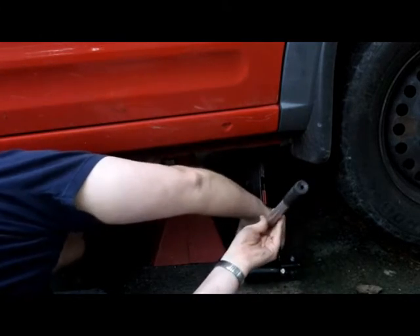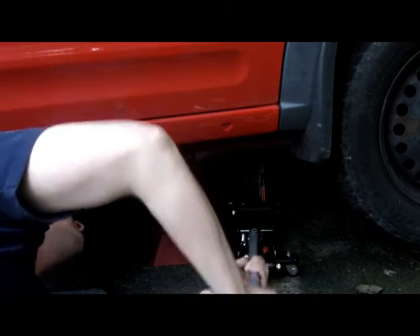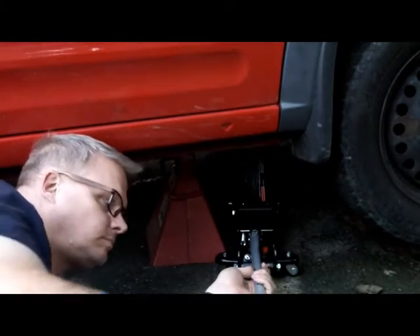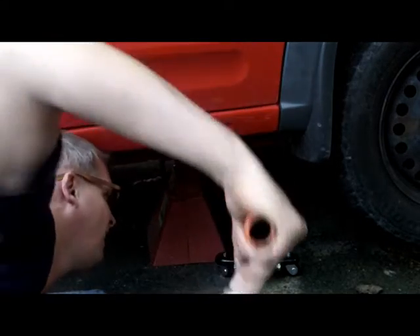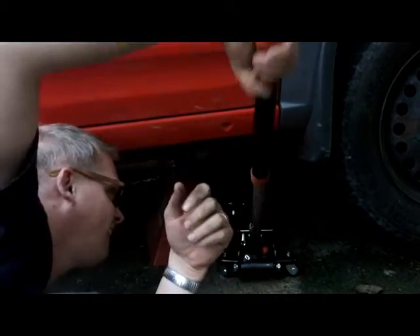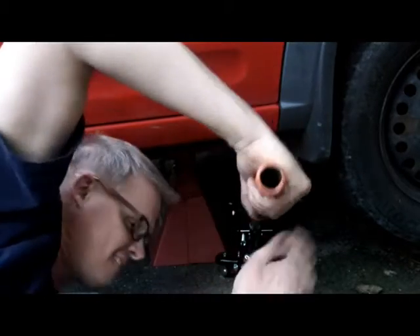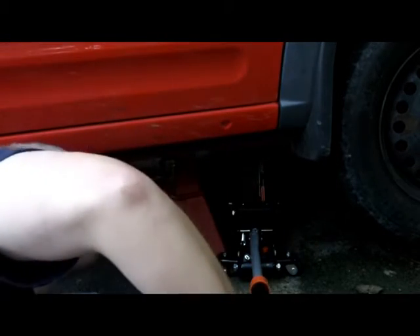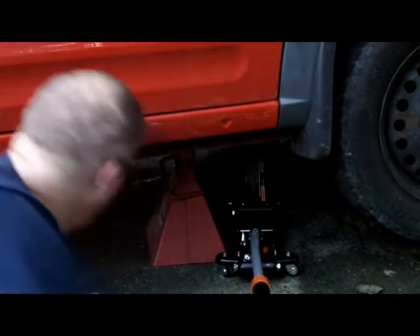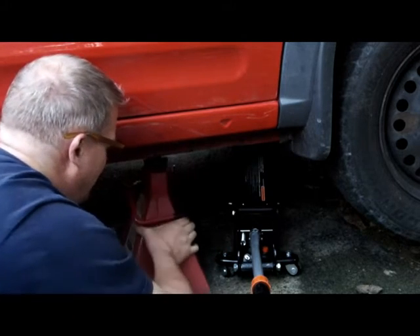We're looking for a good safe position to raise the vehicle. In case you're wondering why you need to use a jack stand — it's because you can never trust a hydraulic jack to stay up. Don't ever get under a vehicle that's only held up by a hydraulic jack because they're prone to leak and let the vehicle drop. That's why you always want to use a jack stand. If you don't have access to one, try cinder blocks or blocks of wood — just about anything solid to hold up your vehicle.